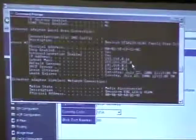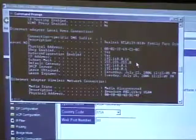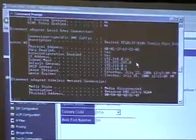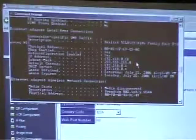So we'll go back in with the defaults. And the thing that we would want to do is confirm that the upgrade succeeded, because when we do this upgrade, a couple of things are going to happen. The first thing is, instead of being 192.168.15.something, we're in the 192.168.0 subnet. So that's the first thing that we've seen has changed. And if it isn't that, then I can guarantee you that however you've gotten into this device and with whatever password you've used, and you can search the web, there are three or four different passwords that AT&T is using for this device now.